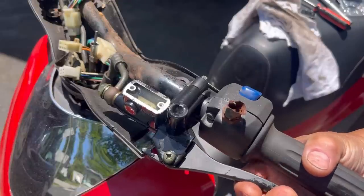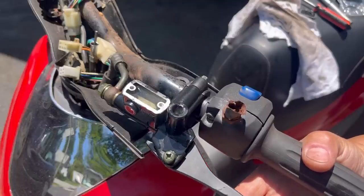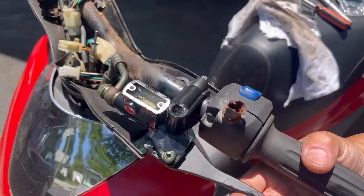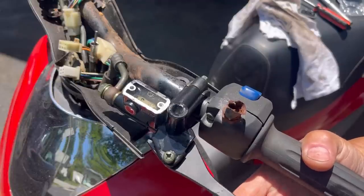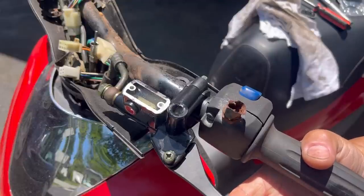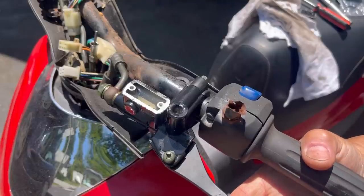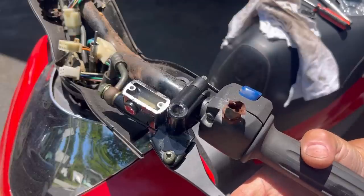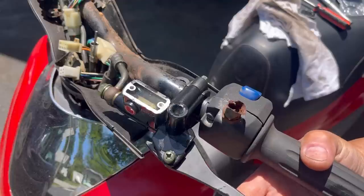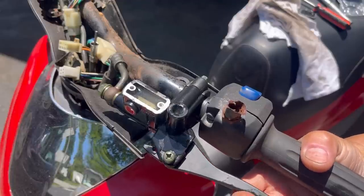In the process, every time you retract the lever, it sucks a little bit down through the brake line into the caliper. Before, on the right one, I was doing it halfway and I felt pressure even without the cap on. I don't know what that's about, but then it loosened up and then started putting more fluid in there. And then I wasn't feeling any pressure, so then I figured, oh, maybe you have to put the cap on, right, to create the pressure. So I put the cap on and kept on doing this for a bit and felt pressure.